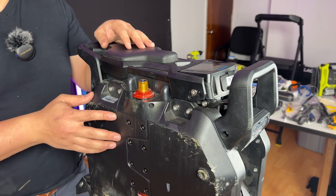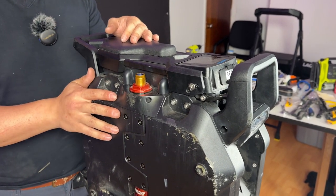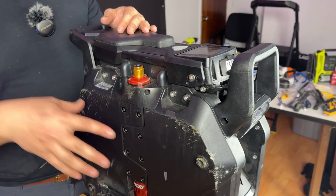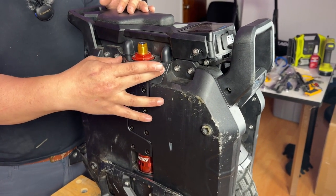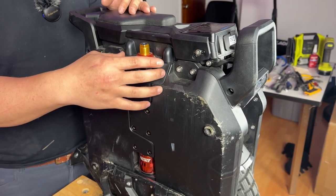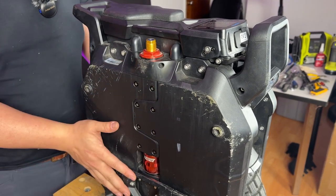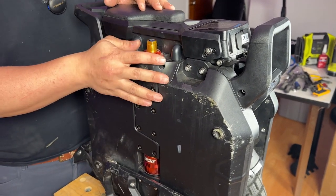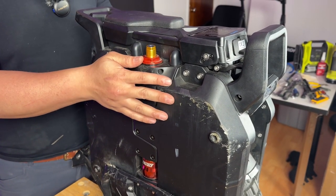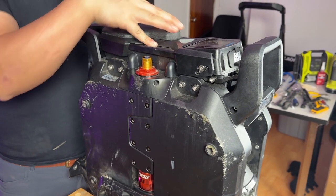With the Sherman S, if you're doing a tire change and want to do it the absolute quickest way, there is the ability to remove the battery pack and have it dangle. You will have two battery cables coming out through the top, and unless you have a good way to hold the battery pack up vertically, you do run the risk of damaging the battery cables. The way I prefer to do it is to remove the battery pack as a whole from the wheel, which involves removing the control board cover and unplugging the battery terminals from where the control board sits.